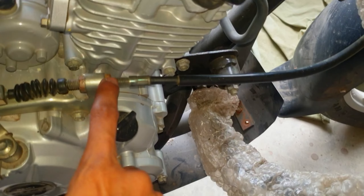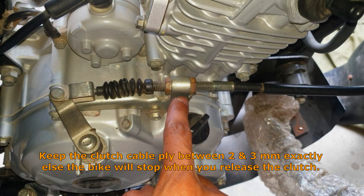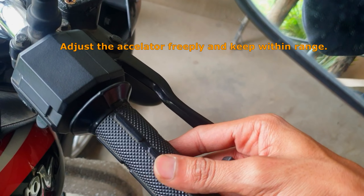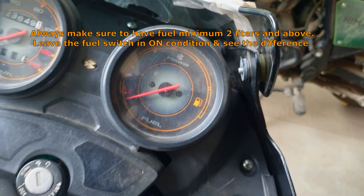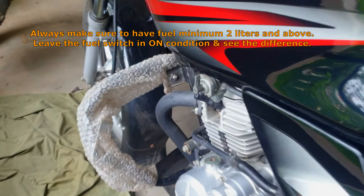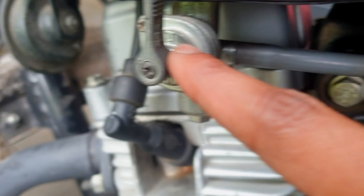Going to the other side of the bike — always keep the clutch cable free play between 2 to 3 mm; this is a universal measure for every bike. Make adjustment for the accelerator so it doesn't give you a morning starting problem; you can find the free play measurement in your bike's user manual. Always make sure you have a minimum of 2 liters of fuel in your bike. Leave the fuel switch in the ON condition after every night.